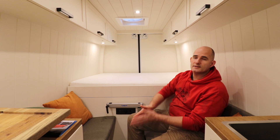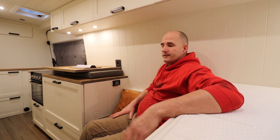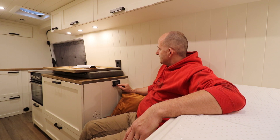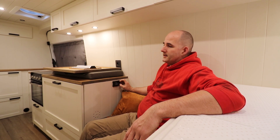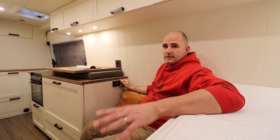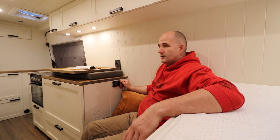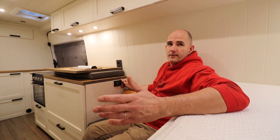We hope this will help prevent our mattress from molding. The next step is to get this heater running. It took us a while to figure out how to prime it. In our version — the new version of the Chinese diesel heaters — you have to press these two buttons next to the arrow together. You'll see the pump icon on the screen and it starts ticking. It might take a while depending on how far your diesel tank is from your heater. For us it's about four and a half meters and it really takes a long time — almost 30 minutes until the heater was primed. So we already did that, and now the big test is to turn it on.